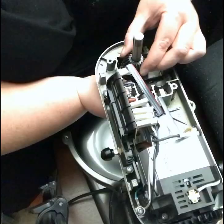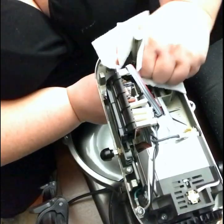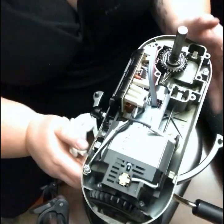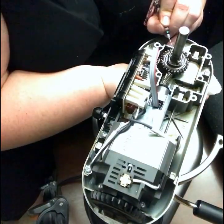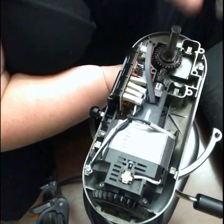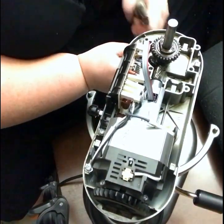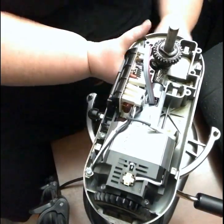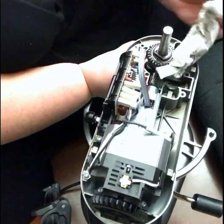Once you get the tension ring off, you can remove your gears. You need to take your machine apart first in order to see what gear is messed up. There is a little tiny pin — as you can see I've removed it — and I need to remove that pin to get to the gear that is damaged. I had to use some pliers, and I think my husband even came in to help me because it was really tight.